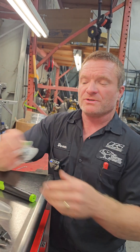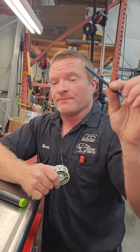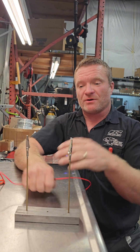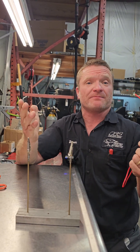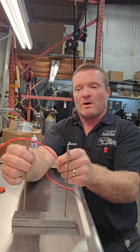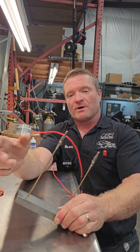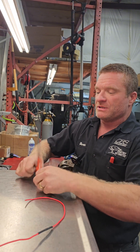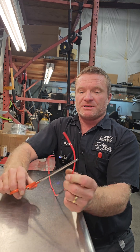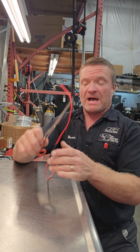When it comes to the process, we use a rosin core solder, we're going to use a solderable butt connector, and simple shrink tubing that you can find at any good parts store. This tool right here - actually my dad made this for me, but you could find something like this at a lot of RC car shops or electrical shops, probably on Amazon. This works really well to just hold a wire for you to work, even under the dash which is the worst area for us to work. Something like this, I'll just put underneath there, it'll hold the wire, I can work on it. Or, I'll use - what do we call these? Forceps. You can find them on Amazon as well. You can actually just put it like this and it holds the wire. You can then work with one hand, solder right here. These things are very handy.